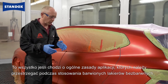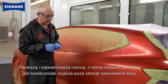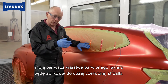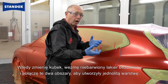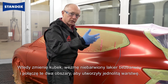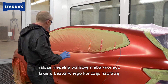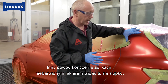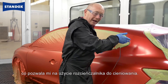Now we come to the slightly more tricky part: the blending into the adjacent panel. The most important thing to remember is you must always go beyond where you have blended the base coat. In this one and a half coat process, my first coat of tinted clear will come to the large red arrow, and my second coat will go a little bit further to the smaller red arrow. I will then change my pot, take my untinted clear, and merge the two surfaces together to give one continuous film. I'll go around the rail and apply a half coat more of untinted clear to the complete job to help with polishing later on. I also like to finish with untinted clear on the pillar so that I can use my fade-out thinner directly.